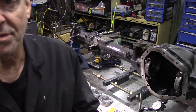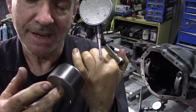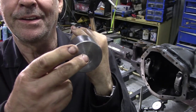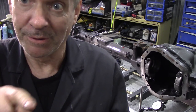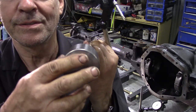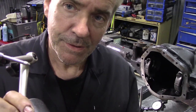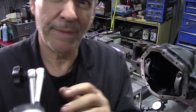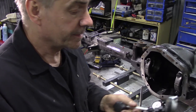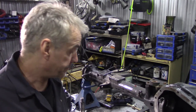When we did the last Rover, I got JP to make a flat disc, a solid mass. It was just a bit of scrap he had on his bench, really. And he undercut it ever so slightly here because the top of the pinion isn't necessarily forced to be round. It might have a little bit of machining in the middle. So you just undercut that, and it is important. Why don't you use a mag mount? Well, the mag mounts, when you take them off, can jar your settings and put them out a little bit. So we don't really want that. We want to avoid that. But we're getting better all the time on our equipment. But you'll see, I've got another one of these diffs to do, just a plain ordinary one, not an ATB.